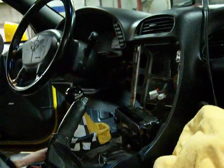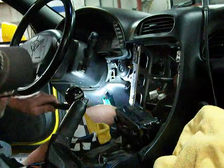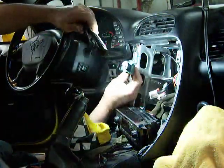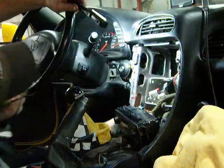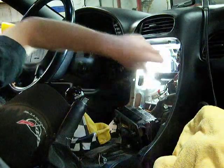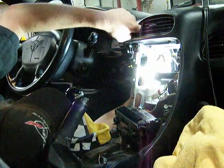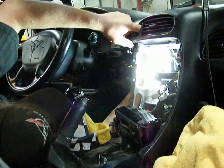So now I've got the new part down here - it was beside the knee bolster. I'm going to run my hand up inside of here. I want it oriented with the big knobs on the right, then reassemble. Put your finger in the hazard hole to find the switch location and help guide it to the hole.